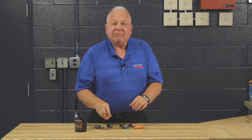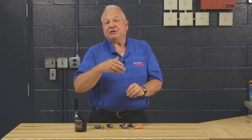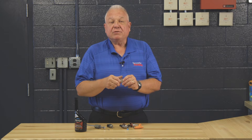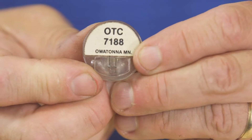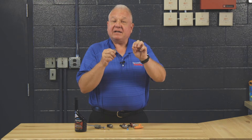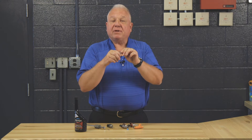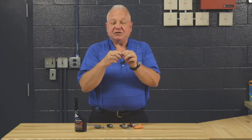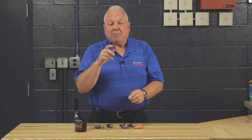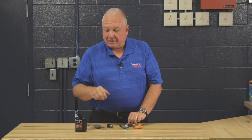If you're ever wondering whether the injectors are firing — if you're chasing a drivability problem or a rough idle — the proper tool to use is what's called a NOID light, spelled N-O-I-D. This plugs into the injector harness: you disconnect the injector electrically, plug this in, and you crank or start the engine and it will flash. You could also use a test light for that, but a NOID light is an easier way to do it.